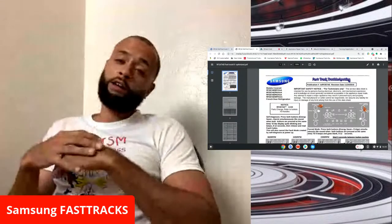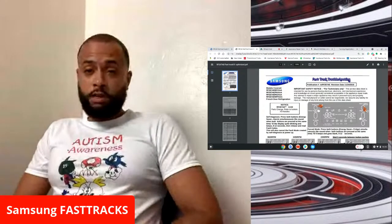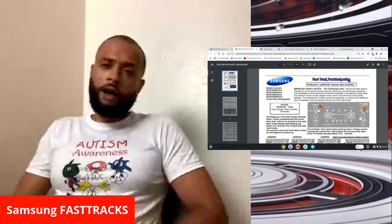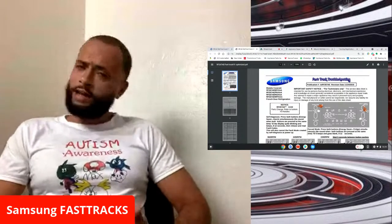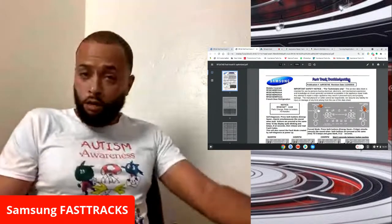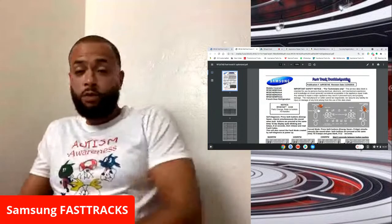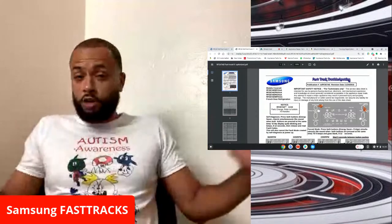Because I'll get a call. Hey, brother B, I got a Whirlpool. It's icing up in the freezer. What you think? You got to send me the model. You got to send me the schematics. We got to look at this thing. What kind of refrigerator is this? Is this an analog timer based? Does this have a board? Is this ADC? What kind of defrost system are we looking at? Are we even talking about a defrost to begin with?